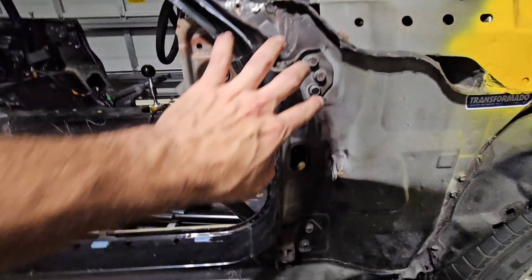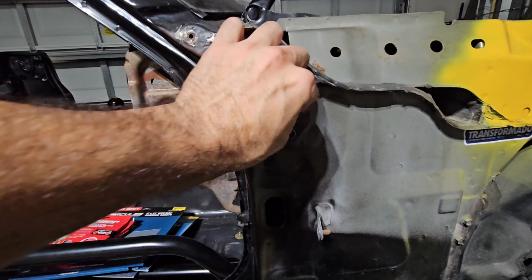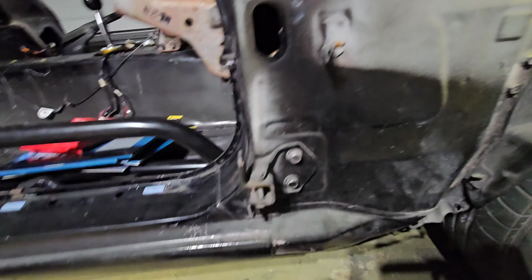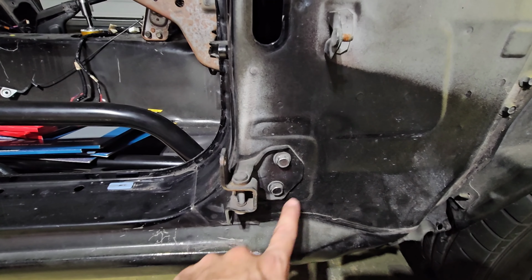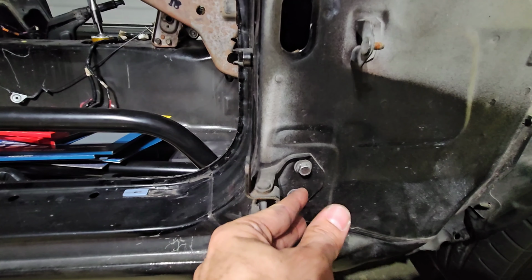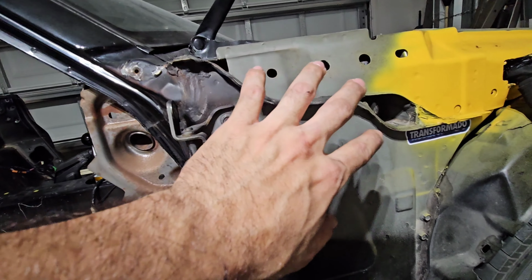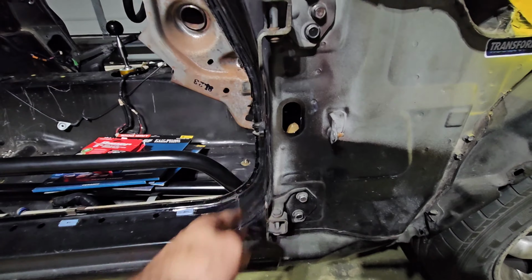First thing you're going to want to do is remove these two bolts up here and these two bolts down here. Now, this one has a center bolt. Mine is loose, so I don't know what's going on with that. But the moment you take out these two bolts, these are the two 12 millimeters. Once you take these two out, this is going to fall. The good news is you're going to have an outline of where this was sitting. So you're going to have to play with this before tightening. You don't want to just tighten it, because you might end up having this deviated downward or more inward. So you want to make sure that the outline is good. That's why you have to tighten it, but very loosely. You'll see what I mean as I install it. So first let's take out these two bolts, and then this is going to come off afterwards.